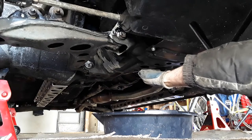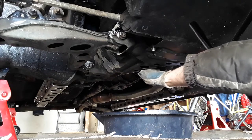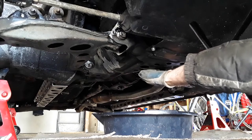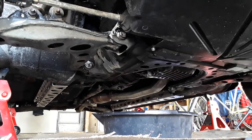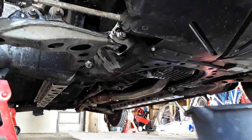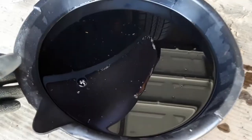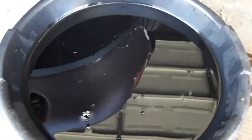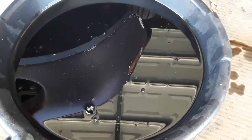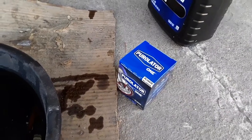One life lesson I've learned: once that bolt is in, even before you torque it down, move the oil pan with all the old oil in it as far away as possible. There's a good chance you'll nudge it and the oil spills everywhere. Also, after the oil is out of the way, I like to look at it to see if there are any films, discolorations, or coolant in it. This batch looks pretty good, which means nothing is crossing streams internally — great news for the engine.